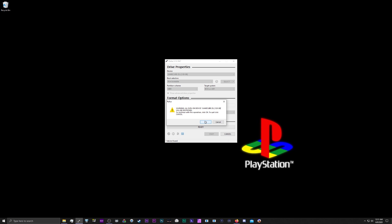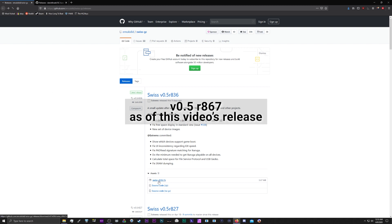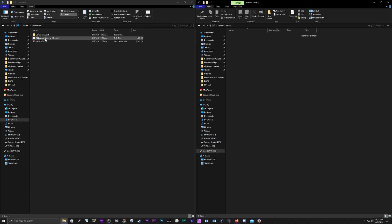Hit start — it's going to let you know all the device data is going to be destroyed. Hit okay, and it'll go through the motions. Now that your SD card has been properly formatted, there are two items you'll want to download and put onto the card: Swiss and the GC Loader firmware. These will be linked in the description. As of right now the firmware is on version 1.0.1. Download that, save it, and grab Swiss. Swiss is going to be used for the management of your games, to change some system settings, and even utilize cheats. Once those are downloaded, drag them onto the SD card. The GC Loader firmware can just be dragged right onto the SD card as is.